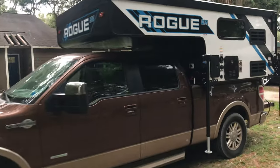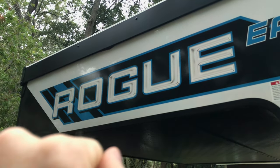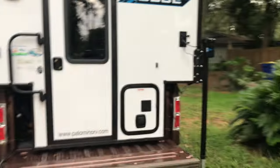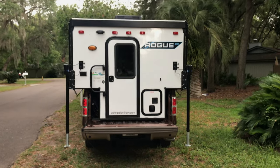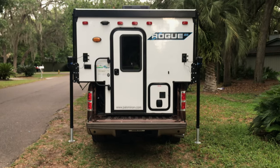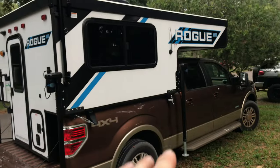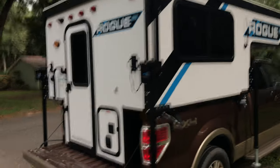In another video we'll mention this, but you can see that little bump of black there — that's a part of the collapsible roof that got stuck in between the side because you really have to tuck this thing in as you pull it down. They say you can turn on the fan and it will suck in the sides while you're lowering, but we have an air conditioner in there and then another kind of weak roof vent — a little wimpy thing that doesn't suck those sides in. So I might replace that with a Max Air or something more powerful so it does that, because it's a pain to have to step on the tire or the rail and tuck in those sides as you go around.